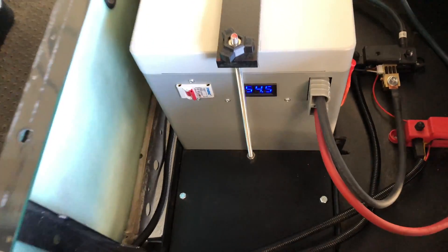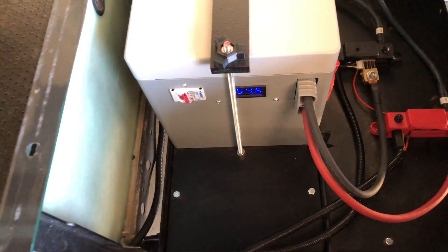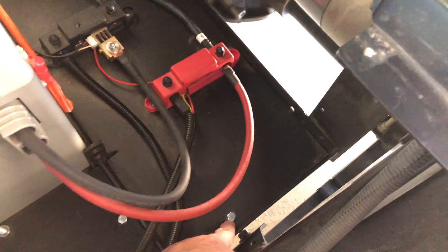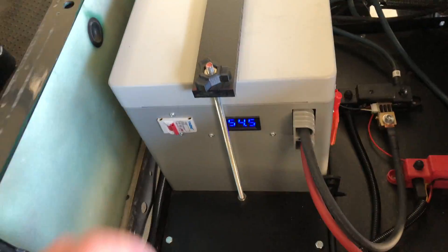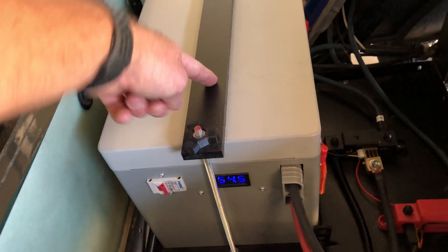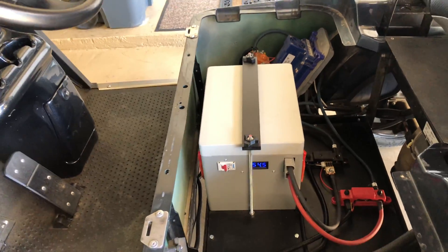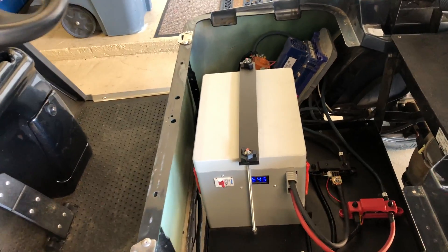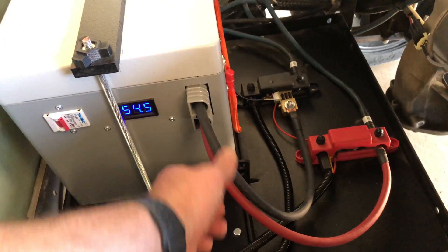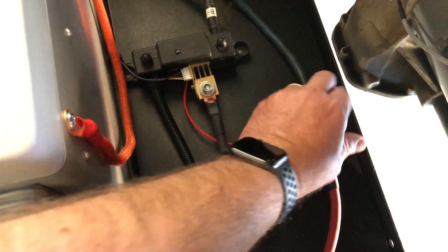I put in a plastic floor — there's a link in the description. It's half-inch HDPE, basically the same stuff they make cutting boards out of. I bolted it down to the battery tray and had to cut two pieces. The little bracket is made from a scrap of the same plastic along with some threaded rods and nuts on top. It takes two seconds to take out and two seconds to put back in. It comes with an Anderson connector which easily unplugs and plugs back in, connecting down to my bus bars.